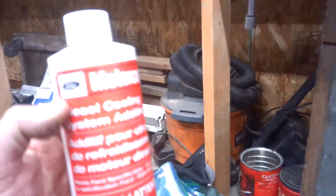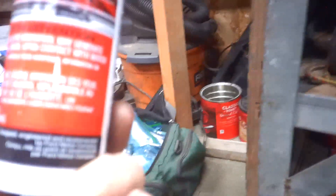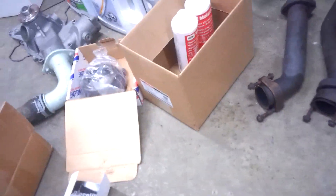You gotta put this in the cooling system — in case you didn't know, the diesel coolant additive; you have to put that in there or the engine will electrolyze like you have no idea. And this is the RTV that I was talking about. They could have gave us a little more than five ounces, but anyhow — they highly recommend using this when doing the oil pan and the timing cover. If you use regular silicone, the oil will foam up. We jokingly said it's gray so it almost looks like Honda Bond, which it probably is to be honest with you.